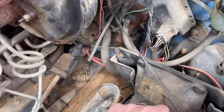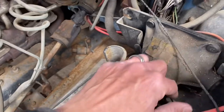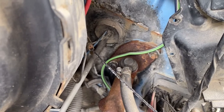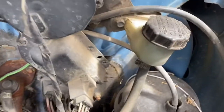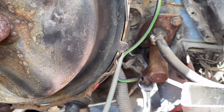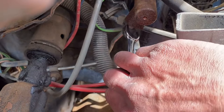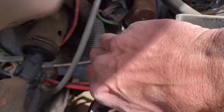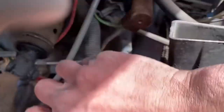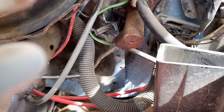To gain access to this area, we're going to get rid of the jack — it might not give us that much room, but it's worth a try. Then I'll take those two nuts off of that rusty old master cylinder. The first thing we're going to do is take loose this line down here — this ends up being 13 millimeter. Then we're going to take that loose and let it kind of bleed out a little bit. We're going to release it at the bottom as well, and that will bleed it out even faster.